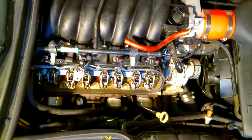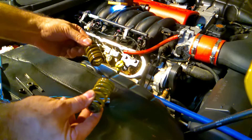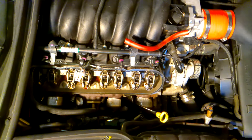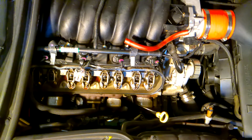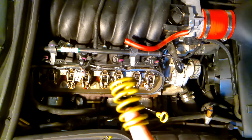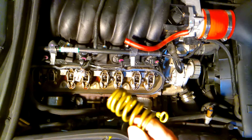And then you can clearly see what the springs look like. I have already replaced these springs — the ones that came out are kind of a silvery-brown color. You can also get ones that are shiny silver, and the GM replacements are blue. As long as they are not yellow, you're fine. But if you pull that cover off and notice the valve springs are yellow, and your vehicle is a 2002 or 2003 Z06 with the LS6 engine, those valve springs are the ones in question.